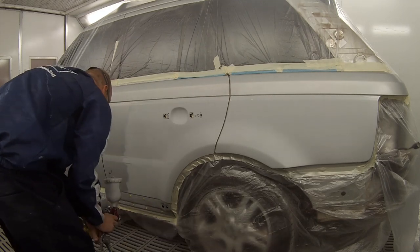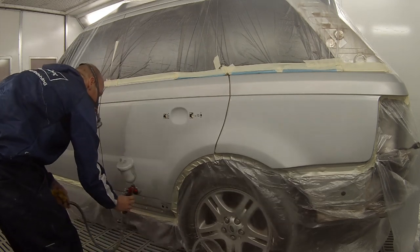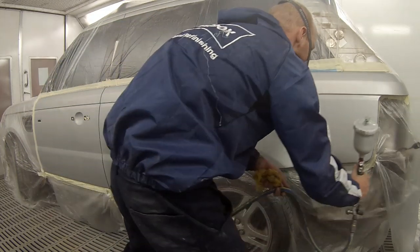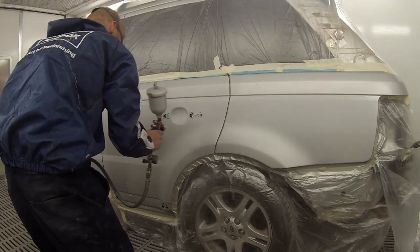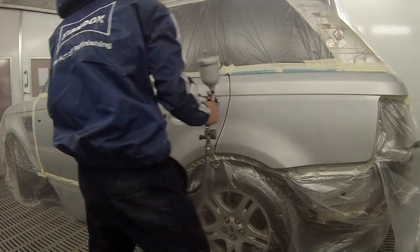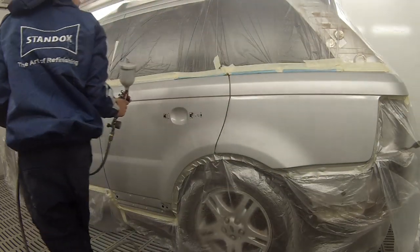The prep work's already been done. I was then taken in the spray booth, masked it all up, washed it down with a wax and grease removing solvent and then ran over the panels using the air. I'll also use that yellow tack cloth that you can see in my hand, run over that about three times, blowing off all the last bits of dust and lint that may have been left behind when using the wax and grease removing solvent.